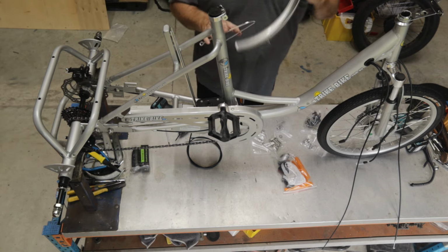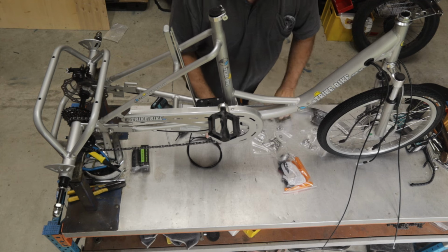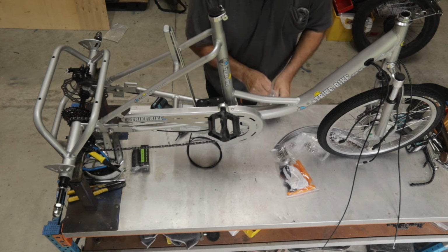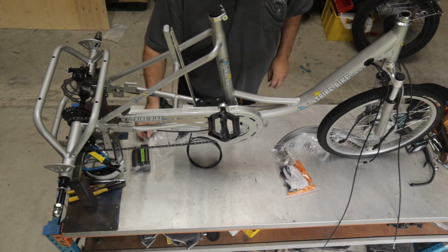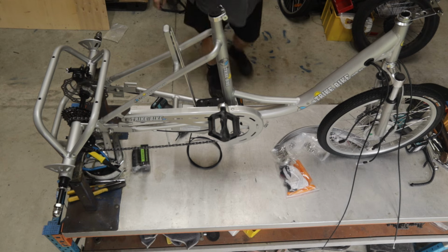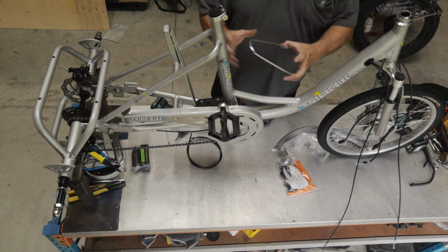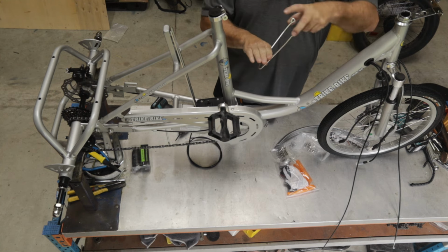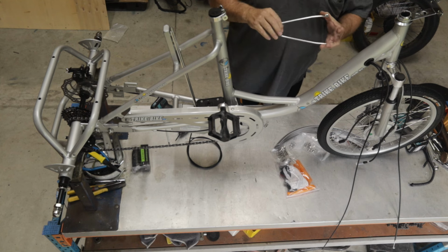Now I have our front mudguard. I've got our mudguard frame that goes there, and I've also got our mounting hardware in the back here. So again, keep that or throw it out. I suggest you keep it, it's just that we've got thousands of them. Now I'm just going to duck away from the camera. I'm just going to put a little bend in here. So I'm just going to put this bracket in the vise and just bend it a little bit. I find that that stops the vibration you get while you're riding.